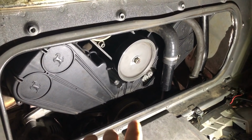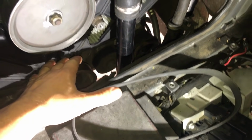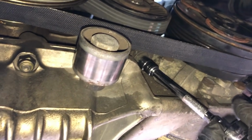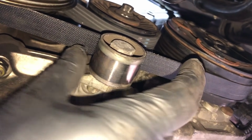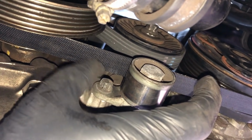So we got our AC belt over here, and then finally our alternator belt. So I'm going to start just by routing it around the pulleys in place, then go under the car and start tensioning that up. I'm under the car now. I'm just making final adjustments on our AC belt by tightening up the 10mm bolt here. I'm then going to do the frequency test on the belt, which needs to be between 156 and 164 hertz. I'll tighten up the 12mm nut up here on the pulley, and then finally this bearing that just needs to ride on the belt here, I'll tighten that up so it just kisses the belt, and then we'll just tighten that 10mm nut up finally.